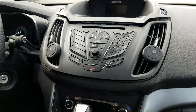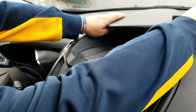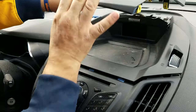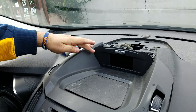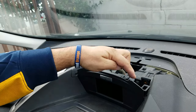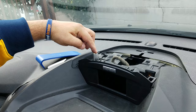The first step is to pop up this top cover and the display unit — it does not have any screws, you just pop it out, and as you can see it has only clips. Then you remove the two screws underneath, one on each side. The screws are T25 Torx.